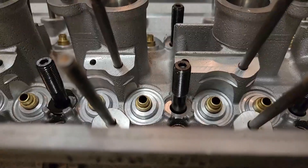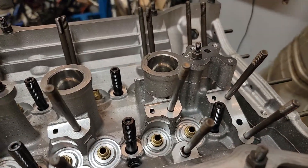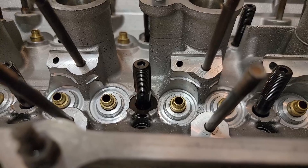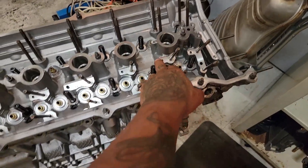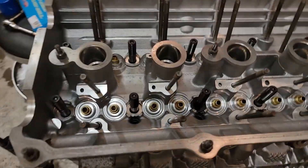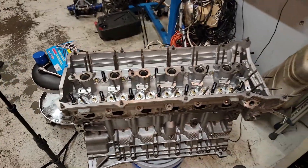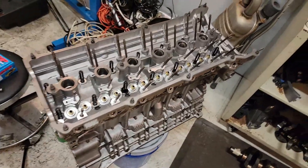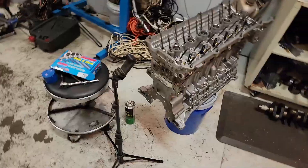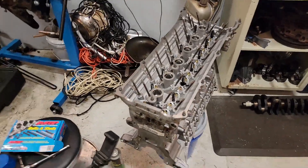I have a big problem - they're not deep enough. It's good work but we just didn't drill deep enough; it's something I overlooked and should have researched. The camshafts sit on top on that machined portion, so even if the studs were threaded down here, they're still interfering with the camshafts - everything would hit. Either way it has to be done deeper. We're trying to figure out if we can get studs that are physically shorter, or if we have to go back in and drill and tap a bit deeper. Either way it'll get done, but probably not for another week to a week and a half. It might cost a bit more but I'd rather fix it for these studs.